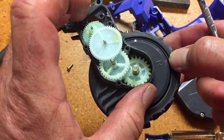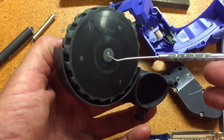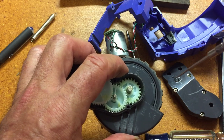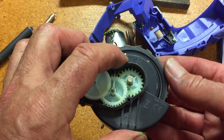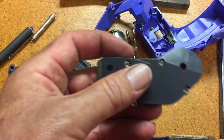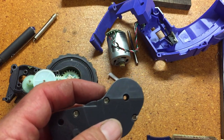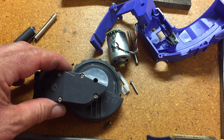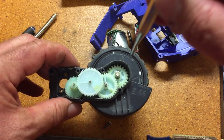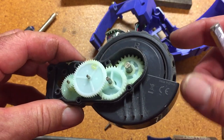The reason I was wondering whether I was going to actually see that by opening this up is because the wheel — you can tell there's something embossed here on the wheel on the inside — and then this pin. I guess the next thing I'm going to try is driving this pin down to see if it'll come out of the shell. That's actually open there — the side shell — but it's not open enough for this 1/8 inch punch to go through. I suppose if you have a smaller punch you could try this. I want to get the rubber wheel off the gear case.